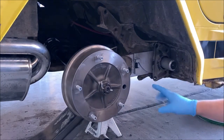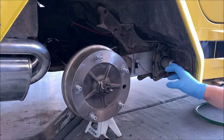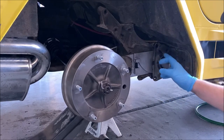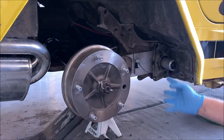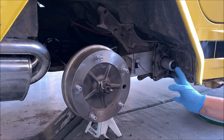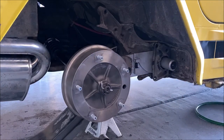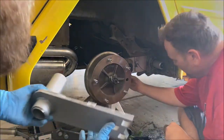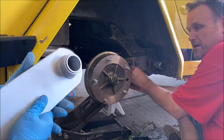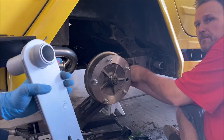So we're going to get these four bolts, which are kind of tough with brand new urethane bushings. We're going to have to get a couple longer bolts to get it started and snug down to get the shorter factory bolts actually back into it. We'll get that bolted up, get those two bolted up, drill that out, and then it's on to the next side. Well, if I would have known we had to drill, I probably would have tried to do that before, but I think actually that was the way to do it. Yep.